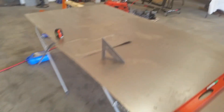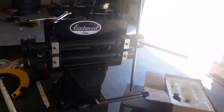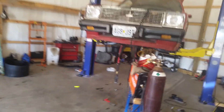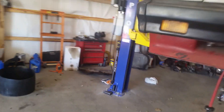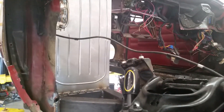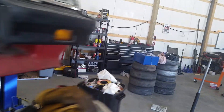On to the metal work today for the Chevette — working on the firewall. Got my 20-gauge sheet metal here; there's a piece I cut out earlier that didn't work. Got the Eastwood bead roller — pretty cool. I've got one side tacked in with some beads in it, trying to make it not so tinny, a little stiffer. So I'm going to try to do another piece.